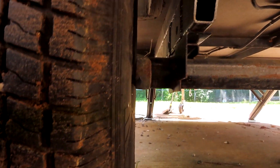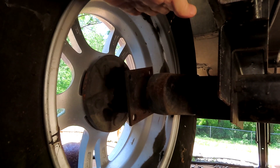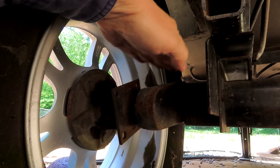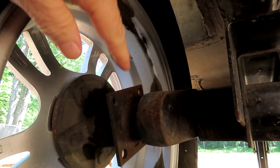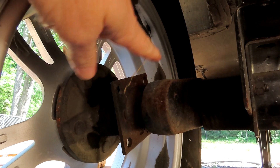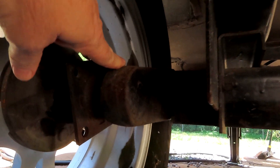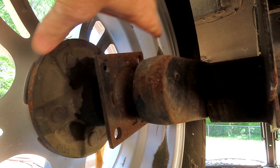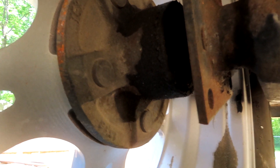Let's look at the axle. You can see that this part of the axle is sloping down toward the ground — it's not parallel, it's got a nice slope to it. That's what these axles should be: downward sloping. They sometimes make them flat and level, which gives a softer ride. This part is the torsion part where the brake goes. I don't have brakes on mine, but you should have a brake drum here, and you don't want to see a lot of oil or grease staining.